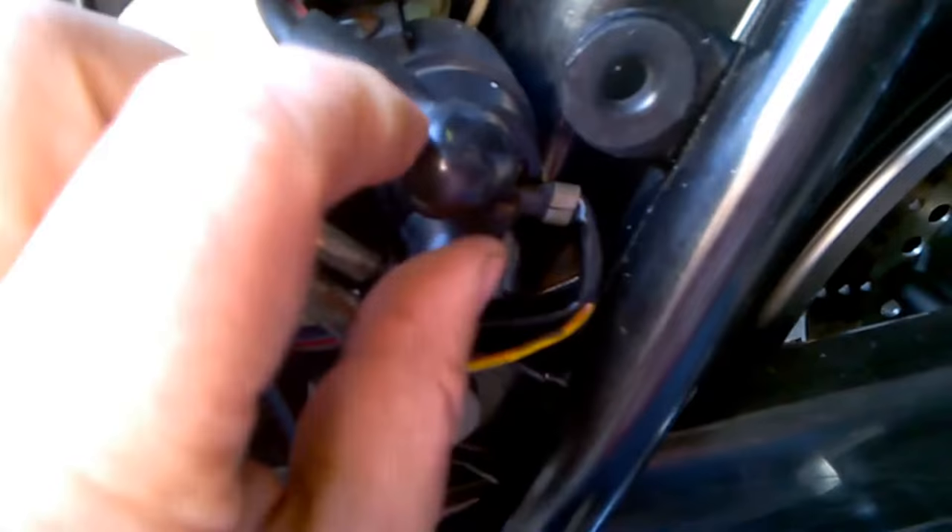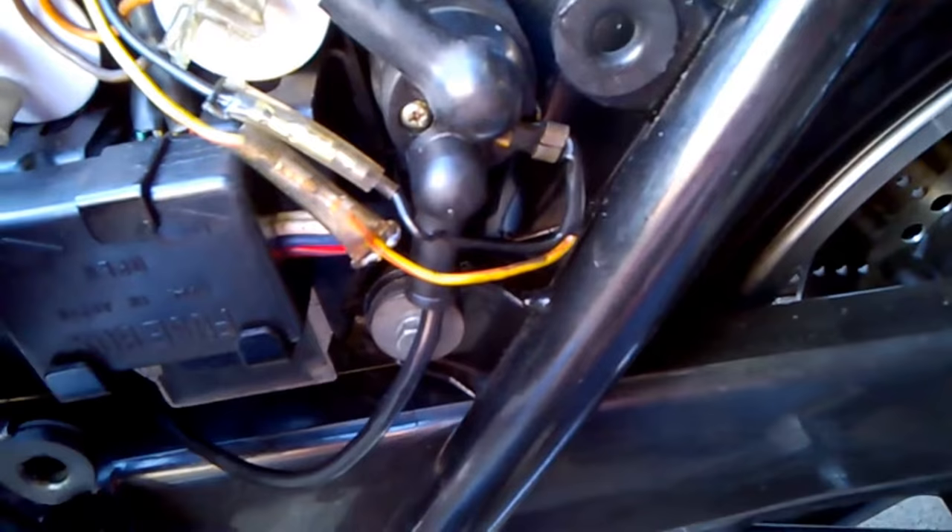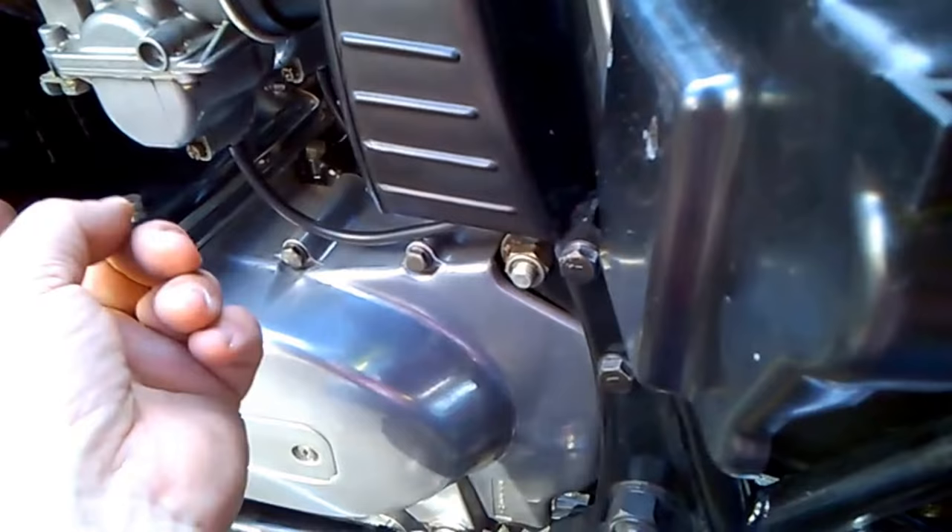Another thing you can do is reveal these contacts under here and just make the circuit across them with an insulated screwdriver. Be really careful not to give yourself a shock - use a screwdriver with a properly insulated handle. Just short across them, and that's fired up the start motor. So what that told me was that the battery was okay and the start motor was okay and earthed properly.